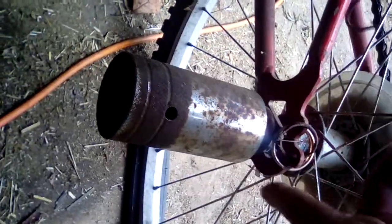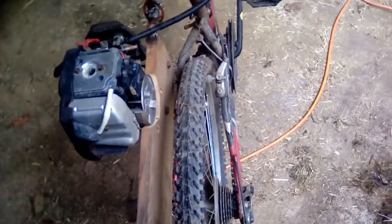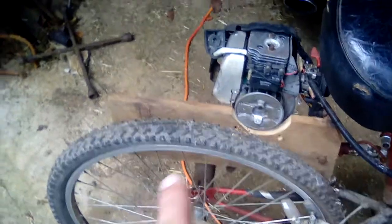Let me get it in the shot here — there it is. You would hook that spring to one of these clasps that I put there. You can get more springs for more tension. The more tension you have, the better power. However, this is the drawback of the friction drive: if the back tire gets really wet and you don't have a lot of tension, it's not going to push the tire as much.